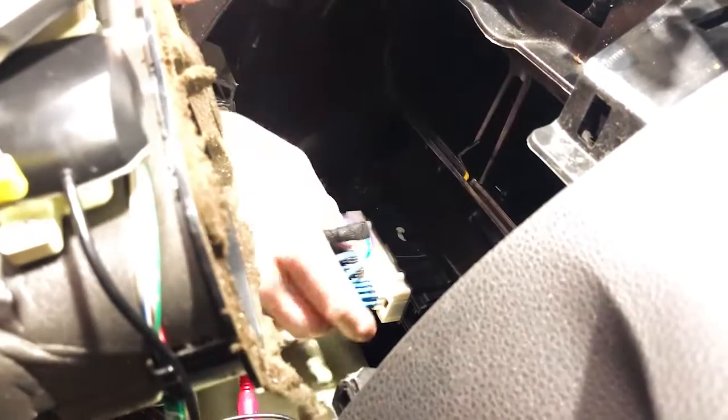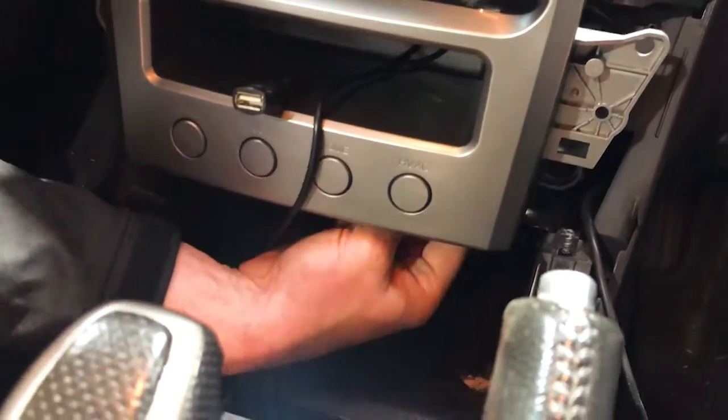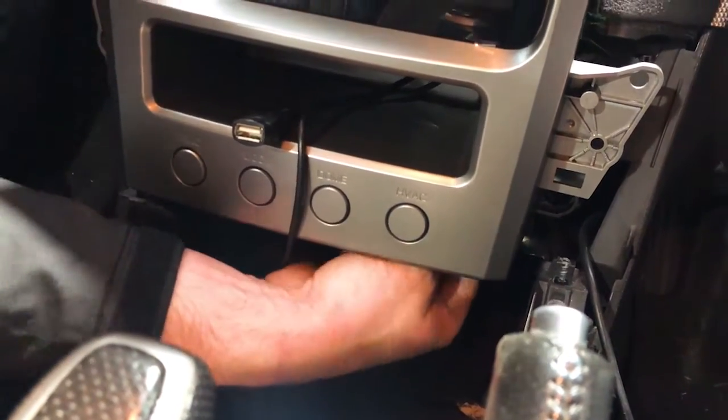Then we're going to put the clip in, and as you push that in, she'll lock in. It's a bit hard to show you, I apologise. She'll push all the way in, okay? And it's pretty straightforward. I mean, it's not something you can really get wrong. And then on the right-hand side, you just want to make sure this plug's hanging down because we're going to clip that in very last on the BCM.